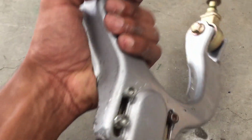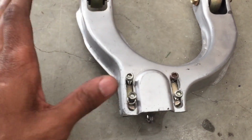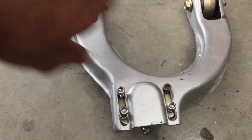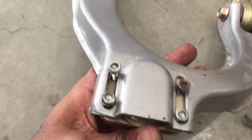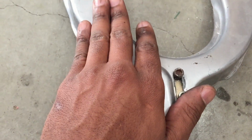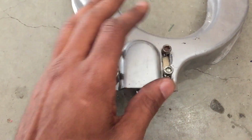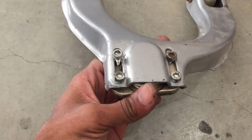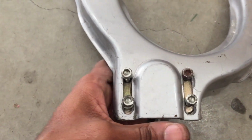Now this right here is your run-of-the-mill, typical, no-name eBay camber kit for any EF chassis, and also I think 90 to 93 DA Integras. If I'm wrong, please correct me. You can see the range of travel that you have is not much at all. There's a couple of companies like Skunk 2 that make camber kits for EFs. Their camber travel is a lot better than what you would see on this, yet they also run with this design. Why? I do not know.